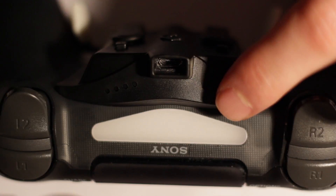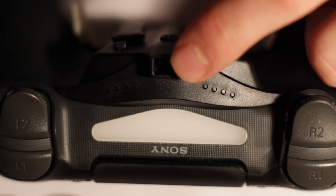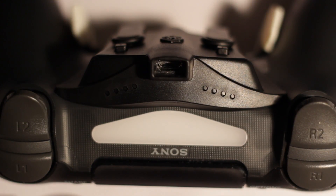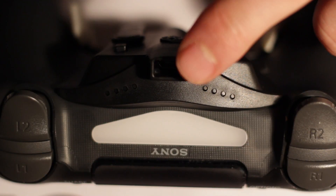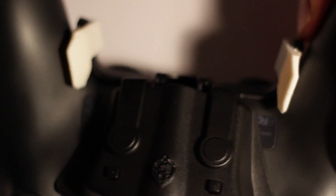On the back side it plugs into the USB port on the DualShock 4, and then there's another, different micro USB port. My theory is that it works by connecting to the controller, enumerating the USB device to make the controller think it's plugged into a PC or PlayStation, then intercepting those commands and sending them back out of this USB port, enumerating as a USB controller.